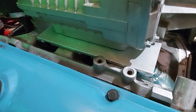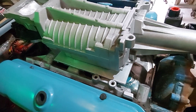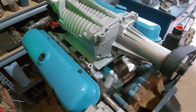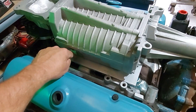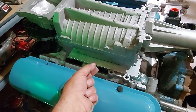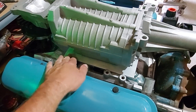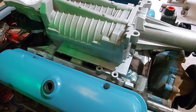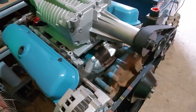As you can see, I got a plate mounted to the supercharger, which gives me a way to mount the supercharger down to the lower intake. I'm going to pull the two plates together — the top one is aluminum, and the lower one is iron, which I'm going to weld to the lower intake manifold.